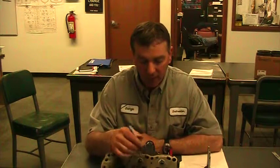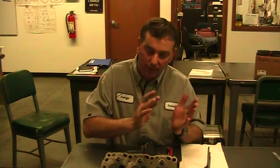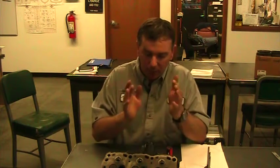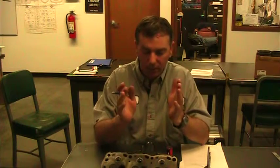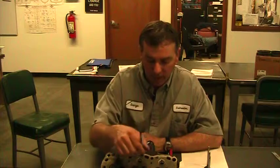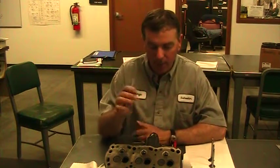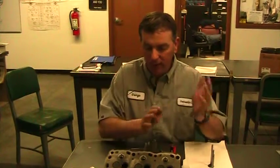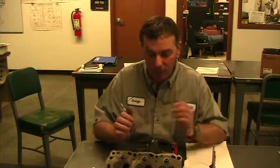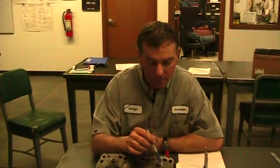So we actually have valve leakage here, and somehow our valve guide has gotten off from the seat. So we need to keep machining the seat itself to try to get the seat centered with the valve guide. We're either going to cut it with a cutter, try to cut it back over here, or keep lapping it until we can machine this side down until it touches all the way around. So it's going to be a process where we're going to try a couple of things.